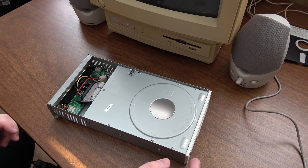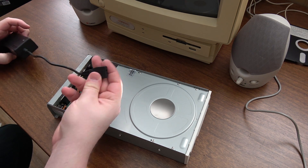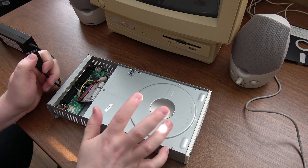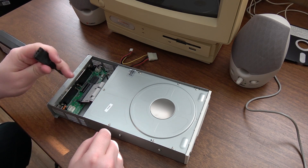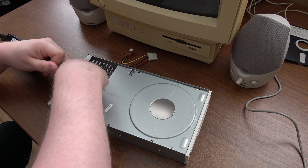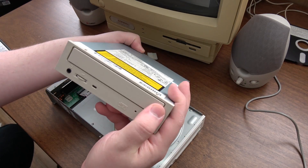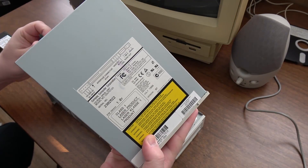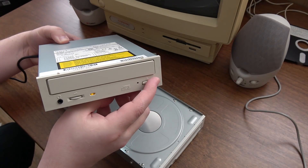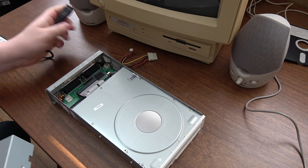Alright, so it is the next morning. I had to go out and grab a couple things to test. I've got this external power supply here, which is just a normal Molex connector. I'm gonna try this without messing with any of the internal circuitry and see if this drive is powering on. If it does, then there's something wrong with the board. If not, then we might just have a dead drive. Yeah, it's just not doing anything. Here's another drive — I'm probably gonna replace this one with this one. If I plug in the power there... yeah. So that's what we should be getting with this, but we're not. So I'm just going to assume that this is dead.